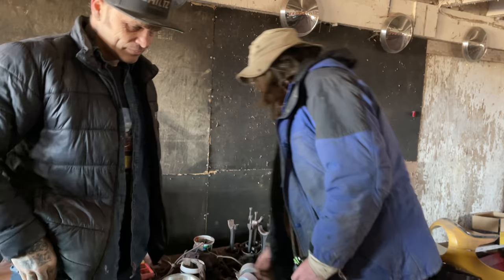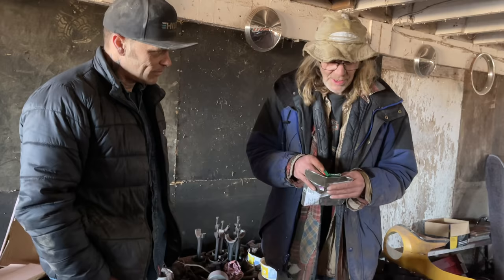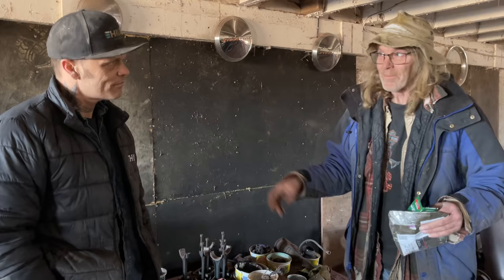So you're coming down tomorrow? Yeah. We're going to tape, and you'll pull some parts off. But make sure you do the servicing on the top end before you start it, because that's crucial. I had one of these, and mine had so many miles on it, the transmission was worn out. It used to pop out of gear wide open in fourth just before I'd shift into fifth and over rev, and all my valves came down and hit the piston, so I had to replace all 8 valves.